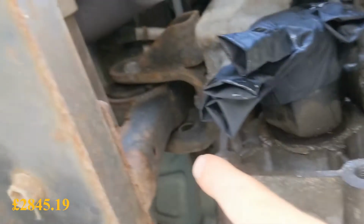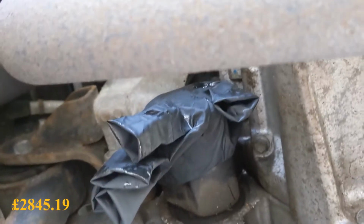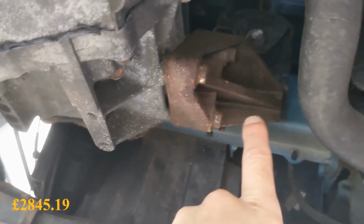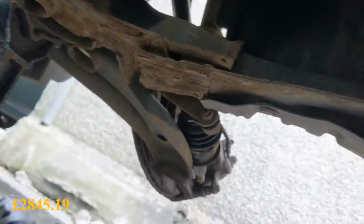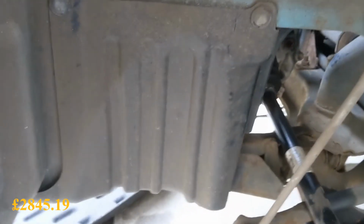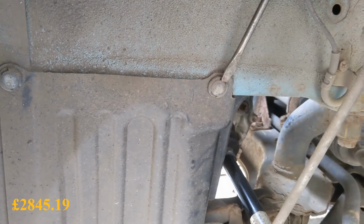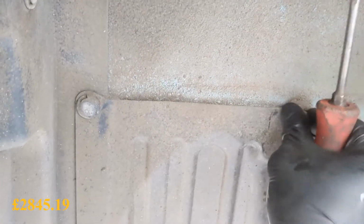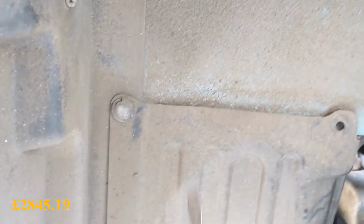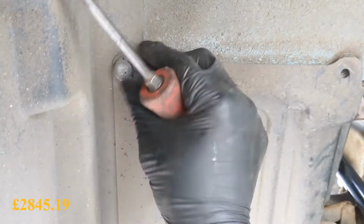Next, there's a engine steady up there that needs to come off. There'll be some more starter motor bolts up there that need to come off. That mount, I cracked them off yesterday, and then this, the other end of this cross member, tidy. Okay, next thing we need is this little plastic cover out the way. A couple of clips that should pop out as long as they're not too crusty. Got the mount off from underneath. Bolts out of the starter motor.